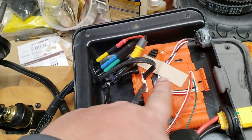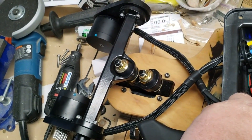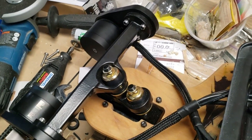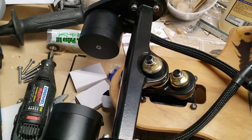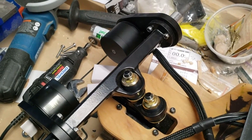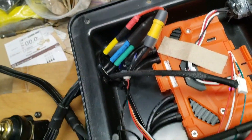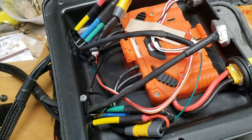Here's another thing — I'm going to disconnect the hall sensors. I don't know if this is normal, but these function the same way whether these two are plugged in or not. Okay, so here they are unplugged — one starts, the other one doesn't. They're not in sync. I tested all the other wires; they're all fully seated and plugged in really well, so there are no loose connections here. Maybe that might help somebody figure out what's going on.